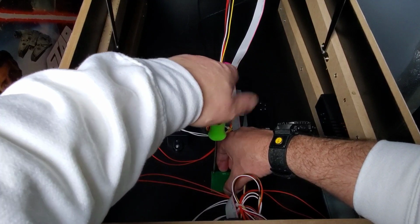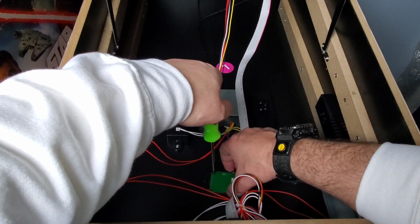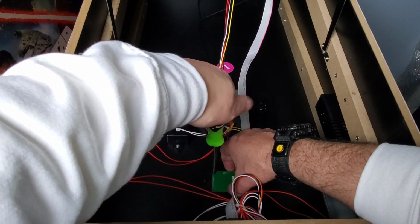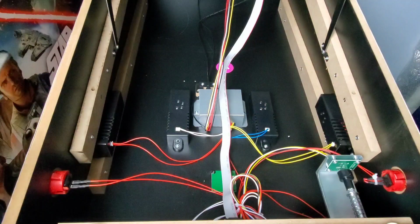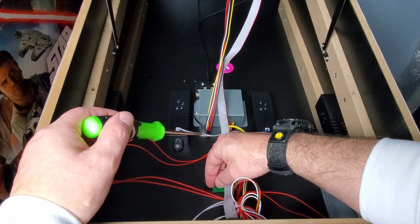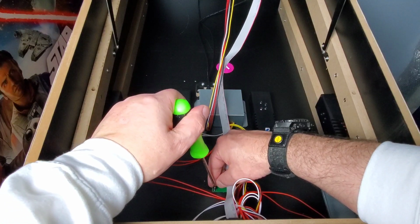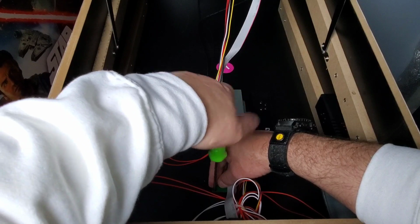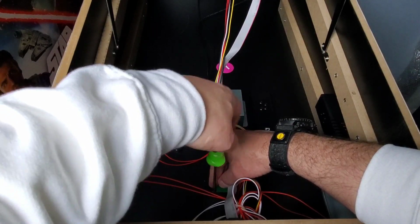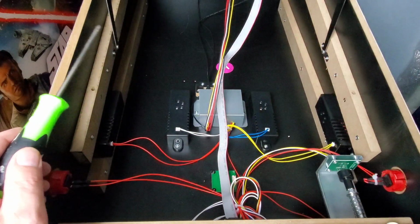And you definitely want to use a screwdriver on this thing, guys. You don't want to use a power drill with this because this chip or the sensor is so thin. It is wafer thin. You can actually wind up cracking this thing if you crank down too hard on it. I mean, they want it secured tightly to the bottom, but definitely don't tighten it down too hard, or else it will snap.